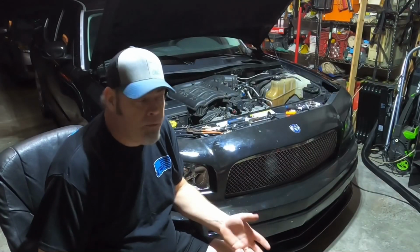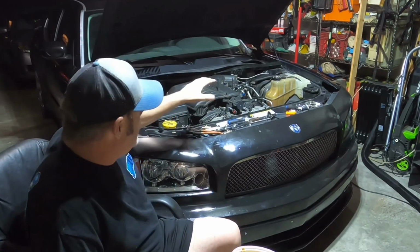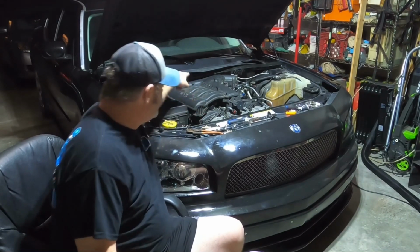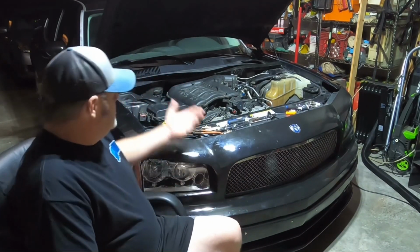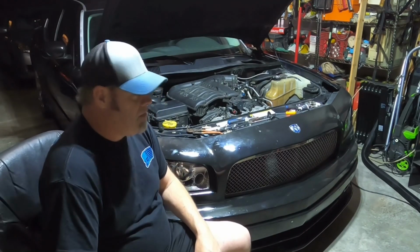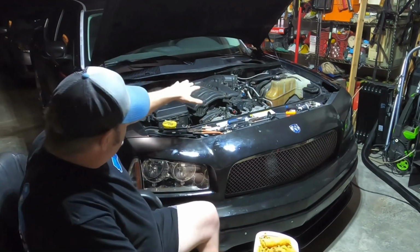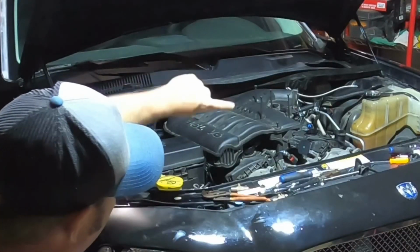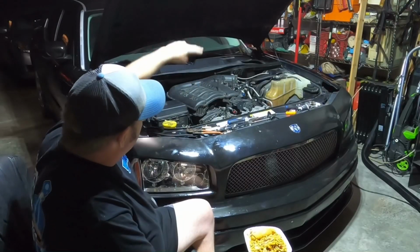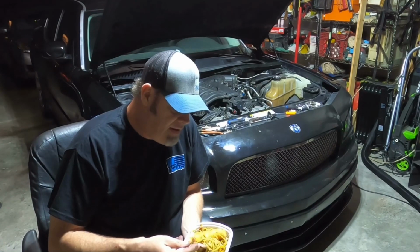Part of the problem I'm having right now is getting back to access all that stuff, all the nitrous lines, the solenoids, the purge valve, everything. I can't get back in there and try to get this back on, and at the same time get the EGR tube back into the back side of the intake manifold. It's fighting me. The support brace is just cattywampus. It's leaning back. It doesn't want to sit right because of the windshield wiper assembly up under there. I have the nitrous lines sitting on the support bar on the back side, and the solenoids. The lines come up into that little crease, but there's not enough room in there because there's also a windshield wiper assembly. So that is where we're at.